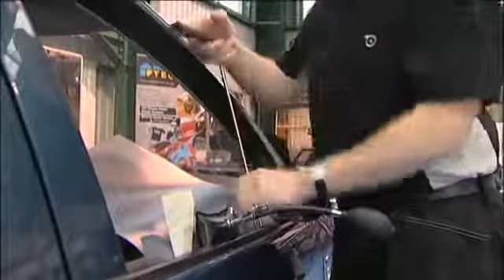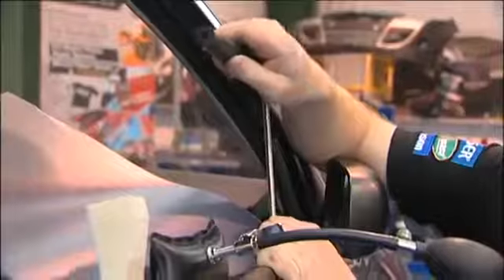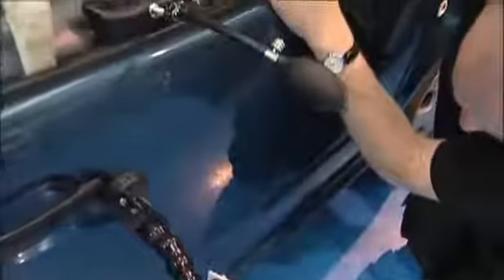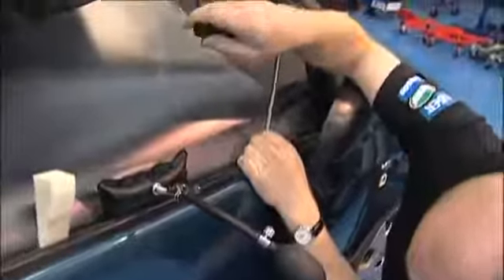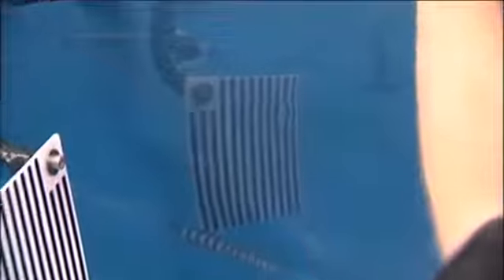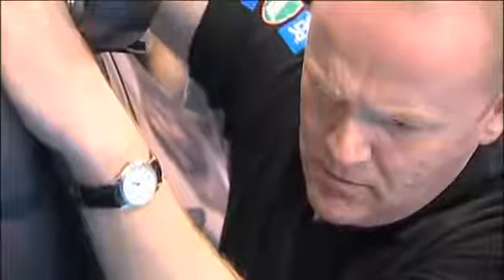To gain access behind the door skin, the specially shaped door bar is chosen from the kit. This is slid behind the panel to gain access to the dent. During the paintless dent removal process, the operator has to watch the repair progress very carefully. A line board is used which reflects onto the dented area, giving a very clear visual indication of the dent and the progress of the repair.